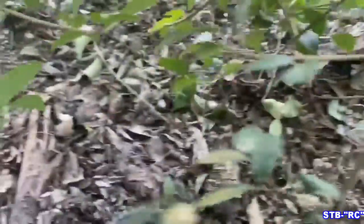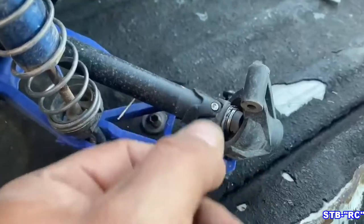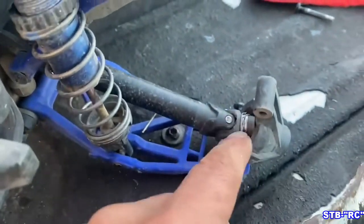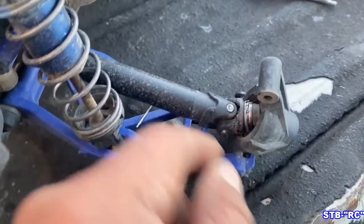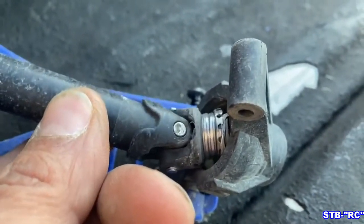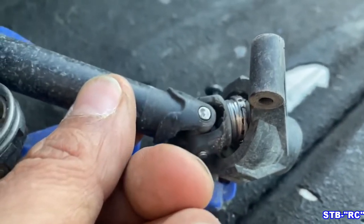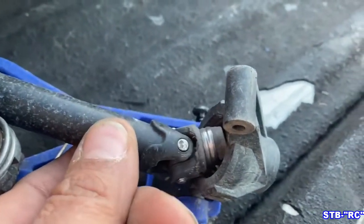So I'm here at the little skate park BMX track — we got ourselves another outer. The only thing we've ever broken on these, like I mentioned before, was the outer. We popped another one. The bearing locks up, seizes in there, and the motor wanted to keep going — so I twisted it off.